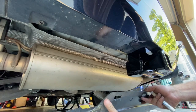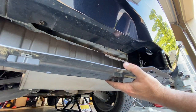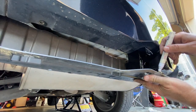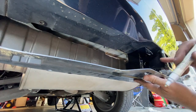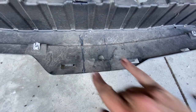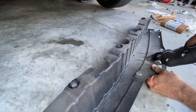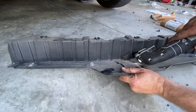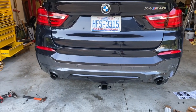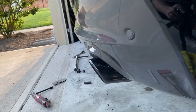Now for the cutting part. Hold the bottom panel up so you can see where you need to cut for the hitch. Line it up in the middle and mark on the inside where you need clearance around the hitch. Cut straight all the way back along those lines. When complete, it should look like this — very unobtrusive.